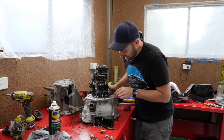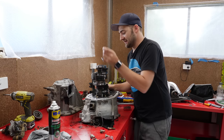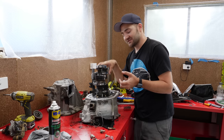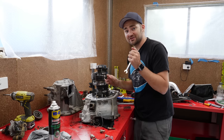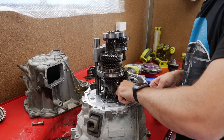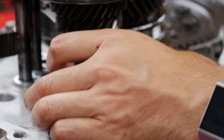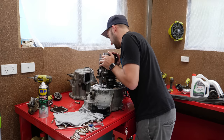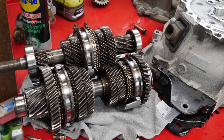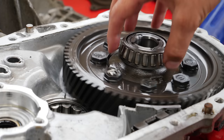I've now worked out that all I've got to do is undo the three bolts that hold this whole assembly in - the shift rails, the input shaft, the output shaft. All this should come out as one big assembly and the diff is just free-floating in there and I should be able to just pull it out. Gearboxes, like engines, are precision items but they're also designed to be serviced. So as long as you don't yank on anything too hard, you'll probably be okay. A full gearbox rebuild involves replacing gears, synchros and bearings but in our case it's just the diff that we're interested in.